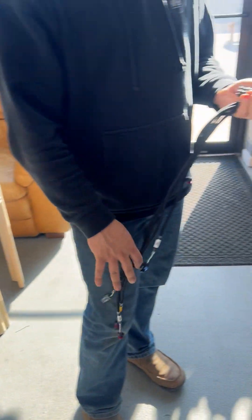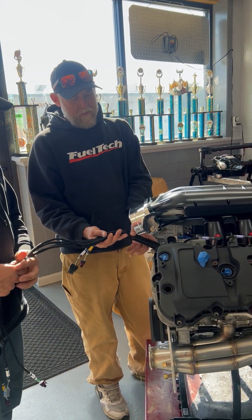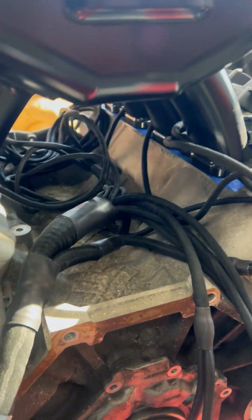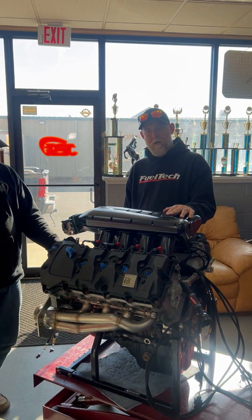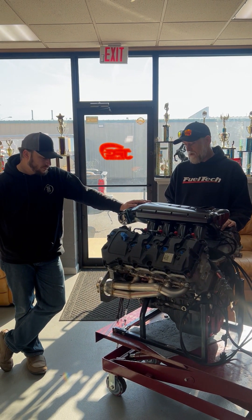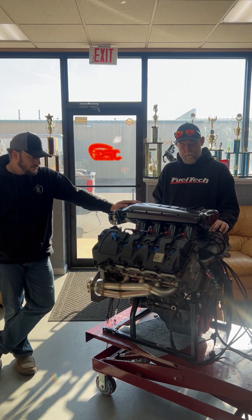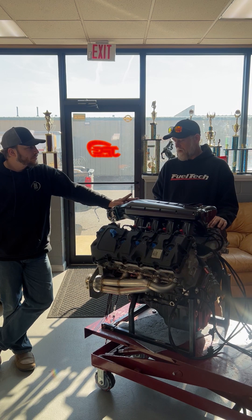They're kind of long, so they can definitely reach as far as you want. The benefit on a coyote is you have all this room under the intake where you can kind of stuff some of this up and hide a lot of it. That is the cumbersome part about the pro harness — it is universal so everything's a bit long, but it's all there, all labeled, and you can cut it to length or coil it up and stuff it under the intake to make it look presentable.